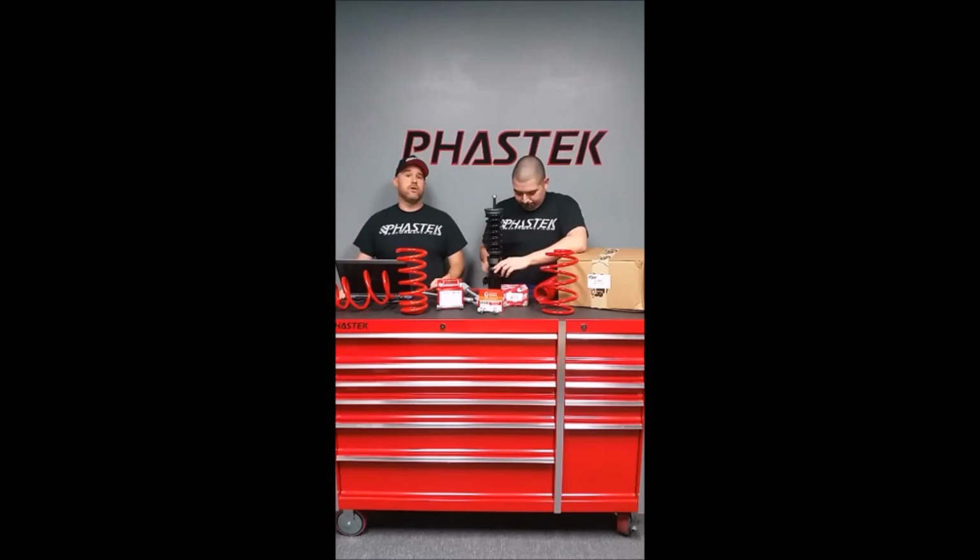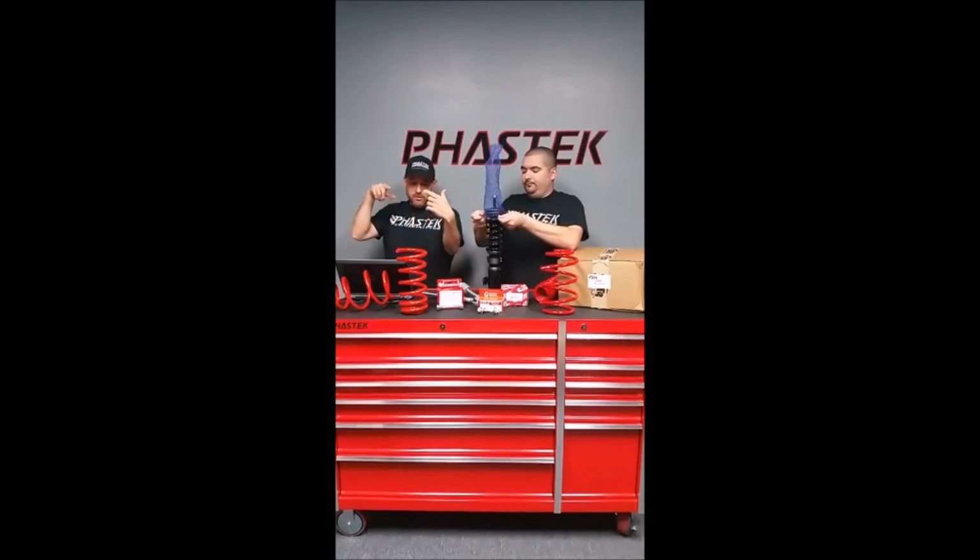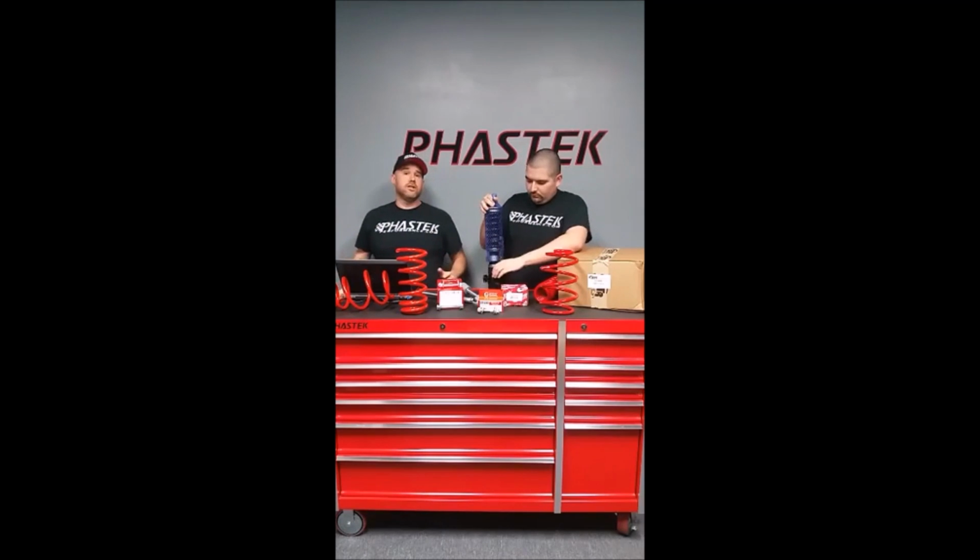So Jay, you asked about clocking the suspension. On the 5th gens, yes, you're definitely clocking the suspension. Basically, when you're hanging springs on the car, the suspension is hanging, so when you tighten down the bolts, it locks everything in place. You can either lower the car in your driveway and clock the bushings from underneath, or wait till you get to the alignment rack, loosen it up, and retighten them. At the shock, you can loosen that up, let it free up, and then tighten it back up, and you're good to go. That's generally what you're going to end up doing.